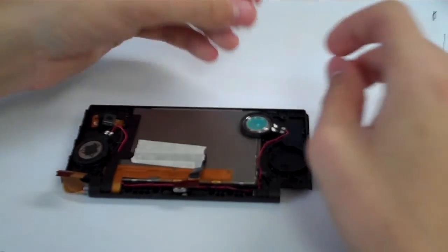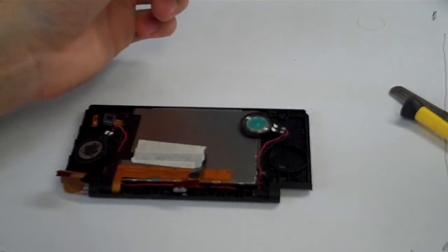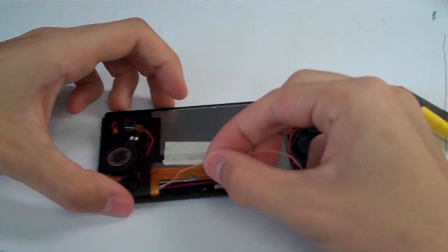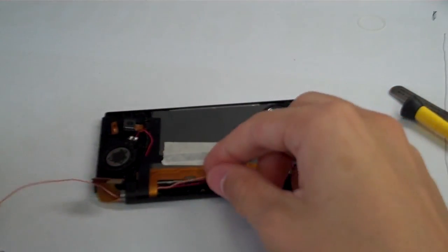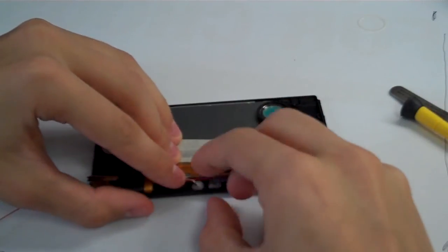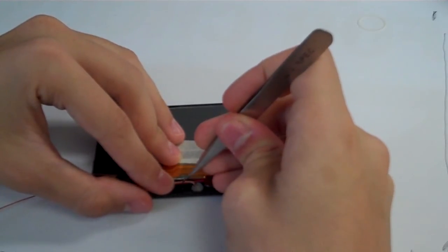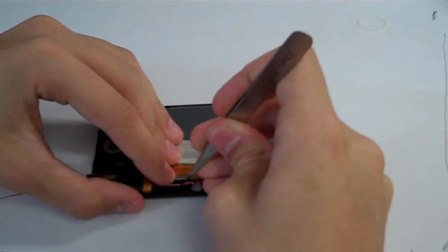Okay. So now we are going to grab our antenna and microphone. Let's grab the microphone first. Microphone is that peach colored one. We're going to slide it through that hinge on the bottom side underneath the ribbon cable on this side. It'll come through the hinge there. Just slides right through. Put the microphone back in its little hole there. Put that in the little cable management track. Press that down, make sure it's in there.